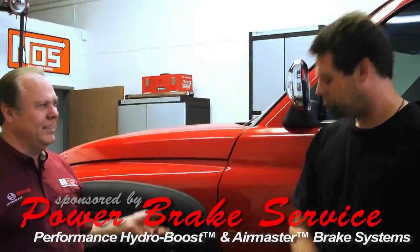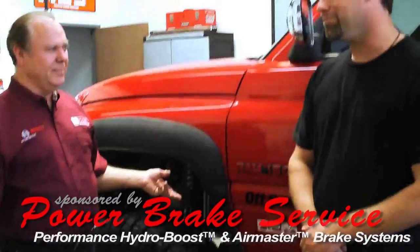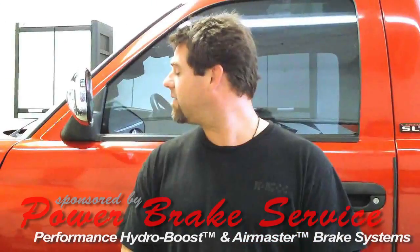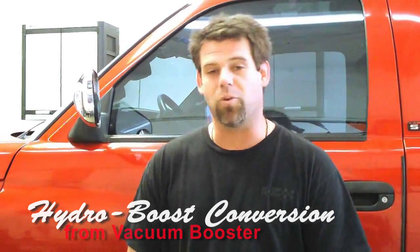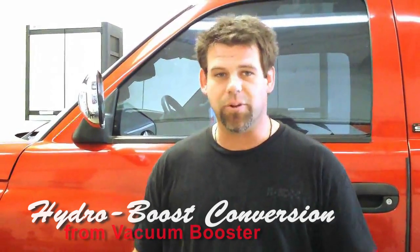Jared, your editor with the off-road magazine, is building this truck as a typical example of off-road trucks and has some brake issues. It's got a larger cam and it's not making enough vacuum. Also, when getting into rocks on steeper trails, there's a real problem where it's not quite stopping on severe angles — it just doesn't have the power and pressure to lock the caliper. We're going to show the improvement from the vacuum booster to the hydro boost and how it's going to help these two issues.